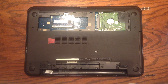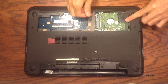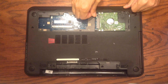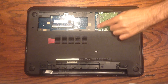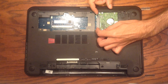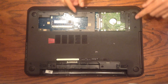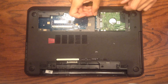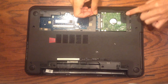The drive is still underneath this plastic edge right here. To get it out there's a plastic pull tab — but first there's a connector here that's connecting the hard drive electrically to the machine. To disconnect from that connector we need to push the hard drive inward, then pull the little plastic tab, and lift up over the connector as we pull it out. That will get it out from underneath the mounting bracket.